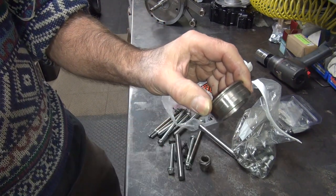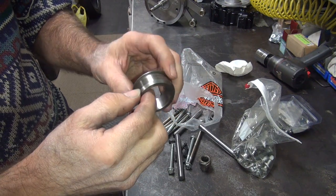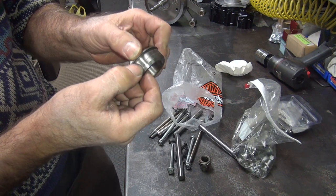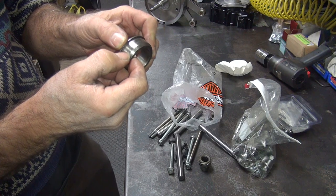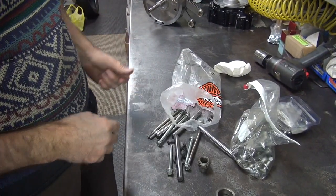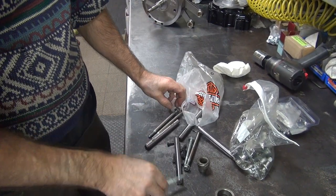Get out your thumbnail — you can see it, feel the roughness. I could polish it out to get the high spot, but it'll still be a low spot right there. It's right next to where the seal lip rides. It might seep oil, it might tear the seal up slightly, but it's not worth the chance.